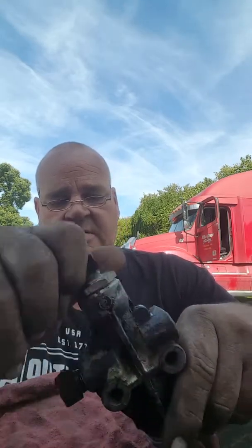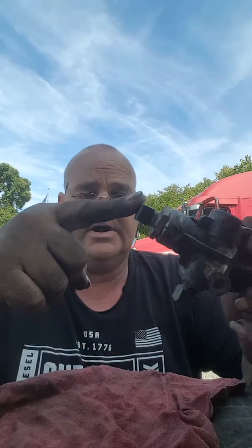This one here was mangled when I got it out of the truck. The others are all right — this one and this one. I don't have to change these two out when I do put it on the truck. But it fits — both patterns match. Any salvage yard that has older trucks, if you can find 97 through whatever, these were the old-school valves and they still work. You can pull them apart, you can rebuild them, clean them up. Three lines: in, out, out. Want that one to go to the rear bags, put the rear bags. Want that one to go to the front bags, put the front bags. It's real easy to do.